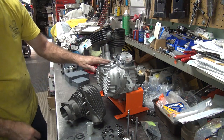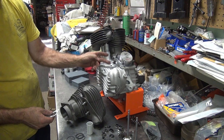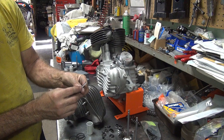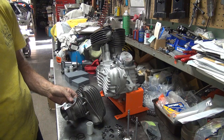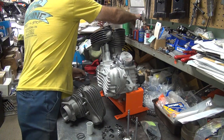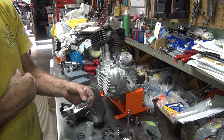Okay, we were having a problem with this one being machined lower. Well, we're supposed to have some other parts that go under here that we didn't put in yet. And he just reminded me that we had a problem with the cam lobe hitting up in the lifter block. We had to grind it out for clearance because we didn't have the parts in there. So you wind up having this and an extra gasket because this one has two gaskets that go on it. So when you add in that, and then we got the other gasket, and of course we have the other gasket. So how much height are we up to now? It's 164 thou, crap. Yeah. So now we're down to 100 thou.